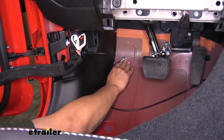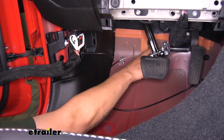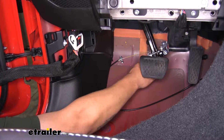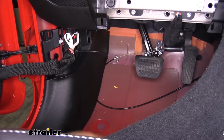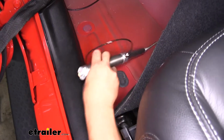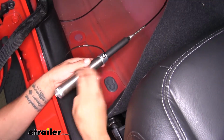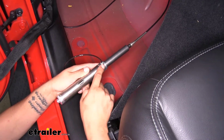Now that anchor point is very important when you mount your pulley. You want that anchor point to be nice and straight, and the cable is sitting in the center of the pulley. But if we follow the cable around, you'll see that I put in a big, gentle loop in it, and it comes right to our cylinder. Now in the cylinder, that's where we mounted that last 1/8" air line, goes directly in here.